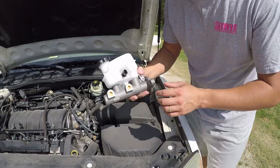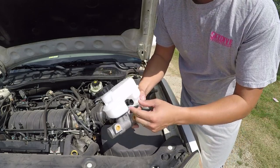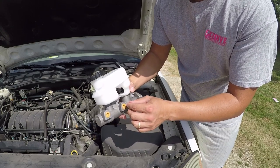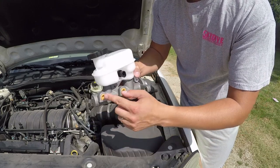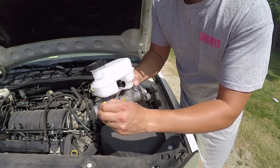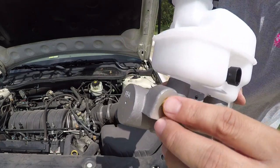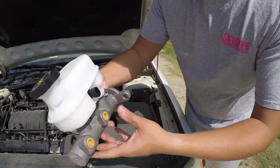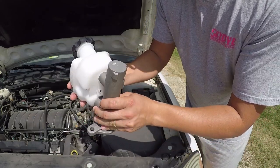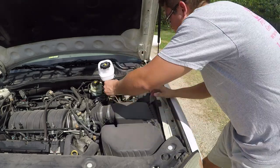So here's what we're doing: first I'm gonna remove the connector from the car to the reservoir, then remove our two brake lines. These are actually foreign material exclusion plugs — I'll keep one in there for now. Then I'm gonna remove the two lines, remove the two bolts, pull it out, put the new one in and see how she does. Looks almost exactly the same.